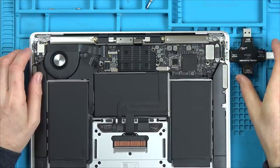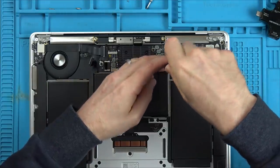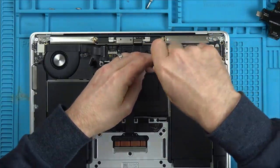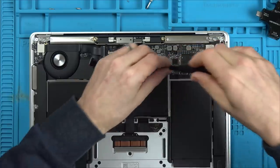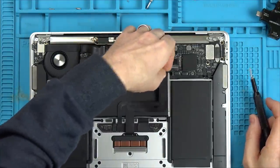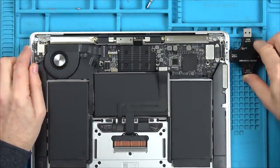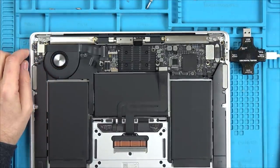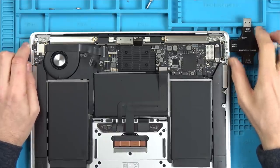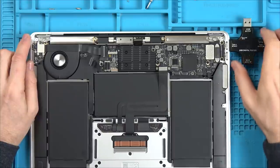No, same as before. So now let's disconnect the trackpad down here. I can't remember if that disconnects the keyboard as well. Just in case maybe water spilt on the keyboard and it's knocked something out down here. Might try it again. No, same thing again. Well, the very fact it's working somewhat there and not here at all, maybe there's a problem with this area here. Because look, it's not doing anything there, is it?